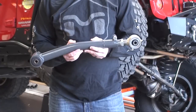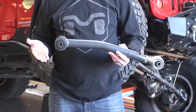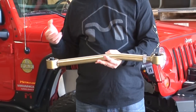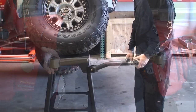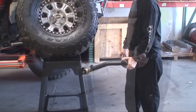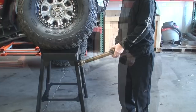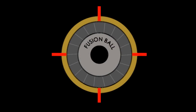Let's look at the functionality of the control arms. Typical control arms have a ball and cup flex joint at one end and an OEM style pressed bushing at the other. Metal Cloak control arms have the DuraFlex joint at both ends. The pressed OEM bushings are excellent in micromotion with no wear surfaces. Typical ball and cup flex joints rotate in micromotion but have exposed wear surfaces causing breakdown over time. The DuraFlex joint is excellent in micromotion with no wear surfaces. In this animation, you can see that the micromotion of the DuraFlex joint occurs entirely in the flex-diffused elastomer with no wear surfaces.